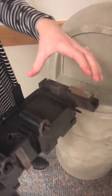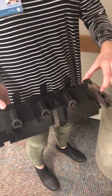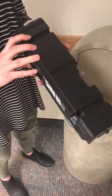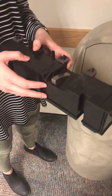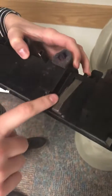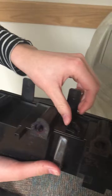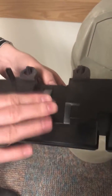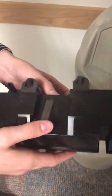We're gonna take it to a trash can. What you're gonna do to empty it is pull back this spring and dump it, and it will pour out. The printer won't recognize that it has been emptied until this clear plastic notch is empty itself. So you've got to pull back this latch right there and shake it all down, because this is what it uses to read that the bin is full.